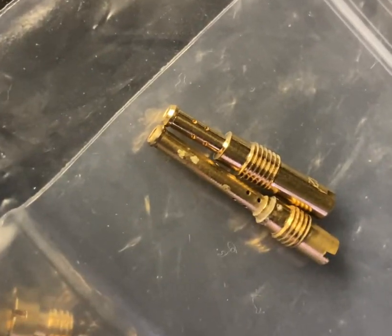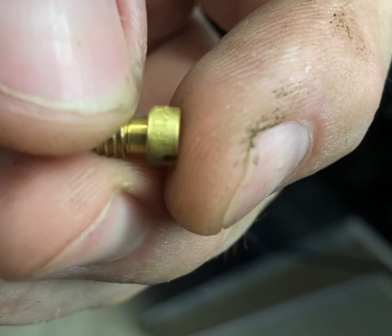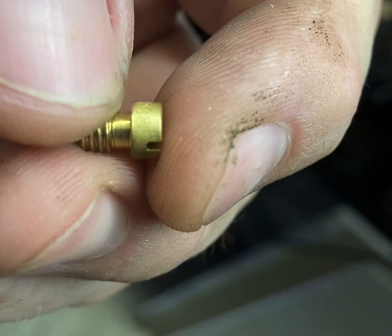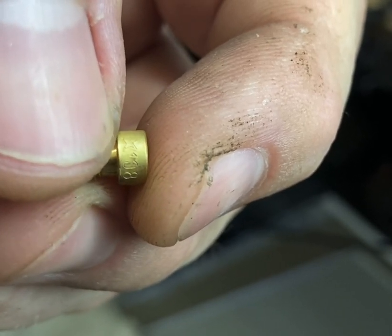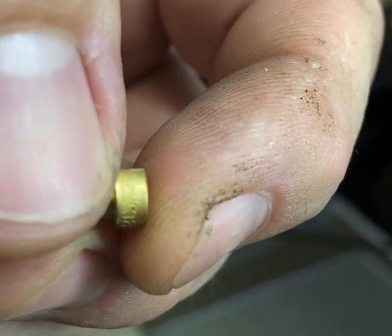Hopefully the mains work, and I don't need that pilot jet — if not, it's all going back. So we got the main jet out here. After getting a clearer picture, it shows that it's actually 108 on the original main jet out of the PZ30, and it does look like all these threads are actually going to fit and be the same pitch.